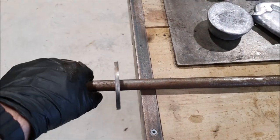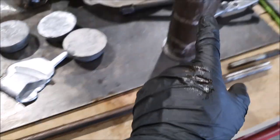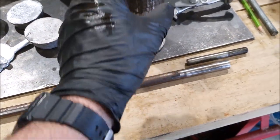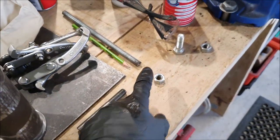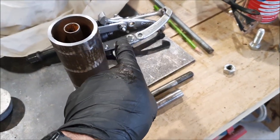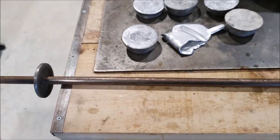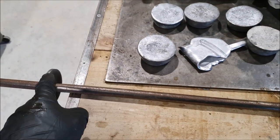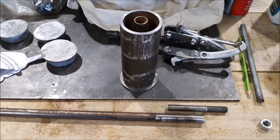I'll probably put a piece of foam on as a pattern, then weld a second piece as a stop around the end. This will slide up and down the tube. The idea is: this heavy weight on here, you hold this end, attach this end to whatever you want to pull on, and then you just slide the weight down along the arm. The inertia of this moving into that stop imparts force, giving you a strong pull.